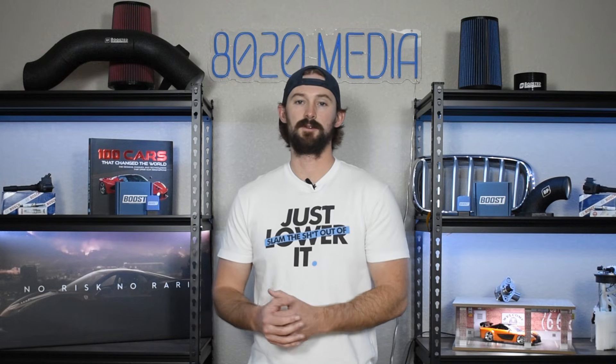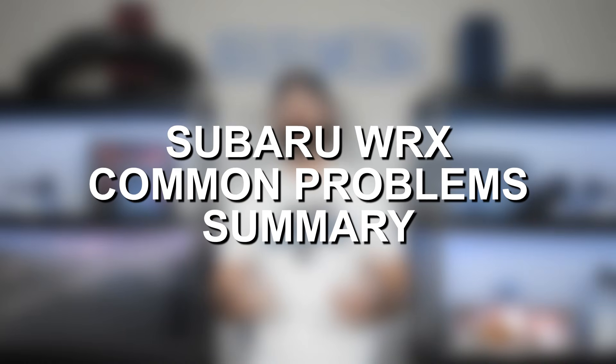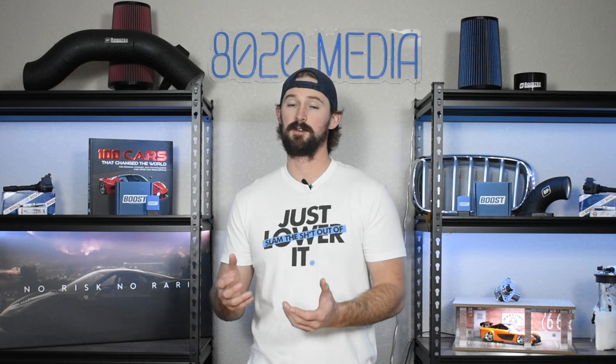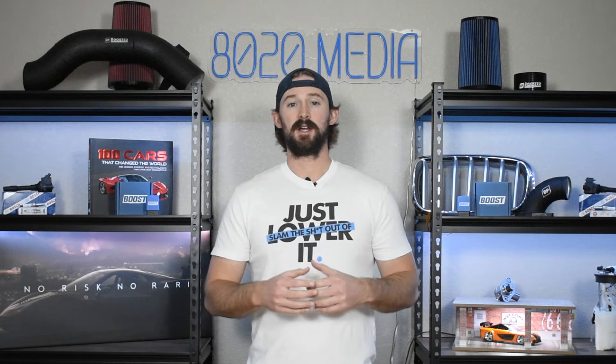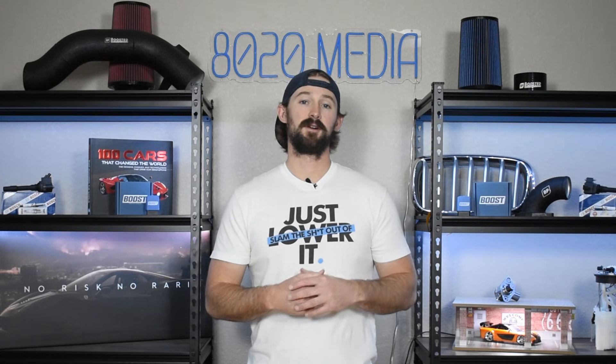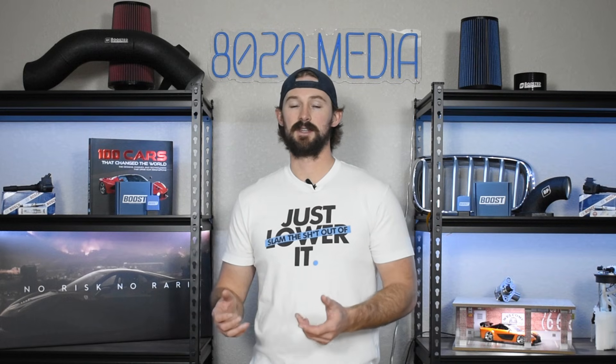Ultimately, your ignition system and fueling system aren't huge problems on these cars, but because they're turbocharged and because they've now moved to a direct-injected fueling system, you're going to run into slightly more frequent maintenance. Those are the four main problems that really affect all of the WRXs. We will have different videos and guides online on all of the different engines used in the WRX, listing out problems specific to those. But I really just wanted to cover the WRX and STI as a whole — and especially the problems you tend to run into when modified, because of course these are highly and frequently modified cars. While they are fun to modify and you can make some decent power out of them, they do have some weaknesses with the engines themselves that it's important to be aware of before you start throwing thousands and thousands of dollars into upgrades.